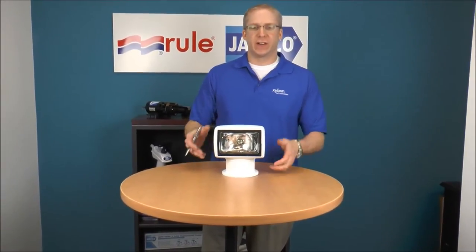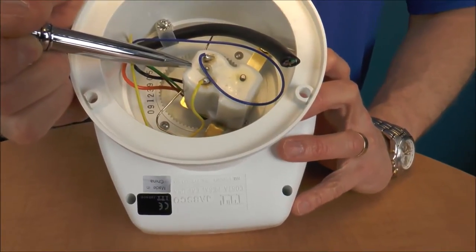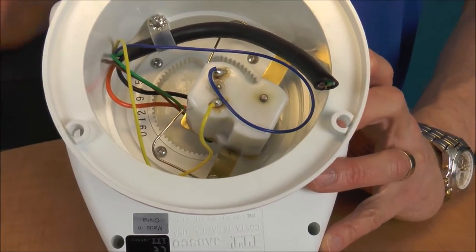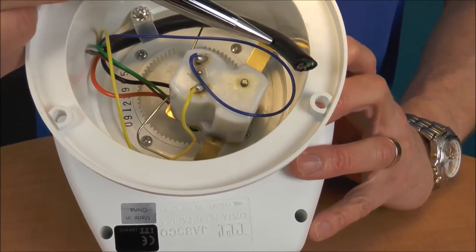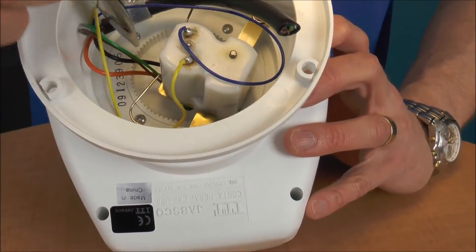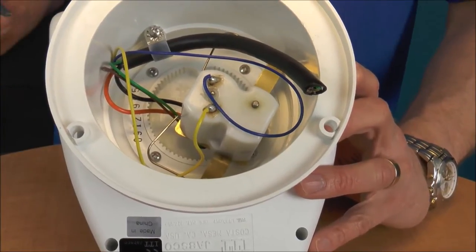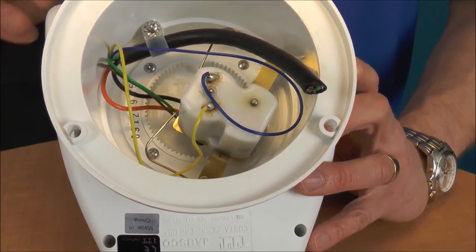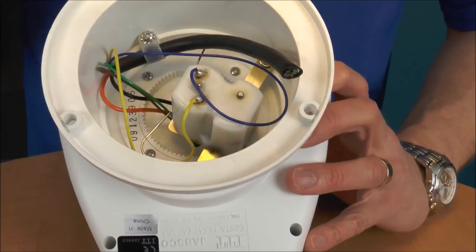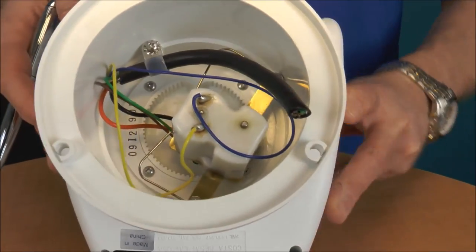Alright, check this out — let's tear this light down. Right here's the left and right motor, and these wires are both negative and positive. We reverse the polarity to make the light go left or right. Here's the main wire harness, and here's a tension spring that keeps the motor assembly against this gear assembly. If we've accidentally forced the light left or right and after that the light gets hung up in one position and you have to nudge it to get it to go further, that tells me that some of these teeth on this gear right here have been either damaged or worn out, and you'd have to swap out the lower half of the unit.